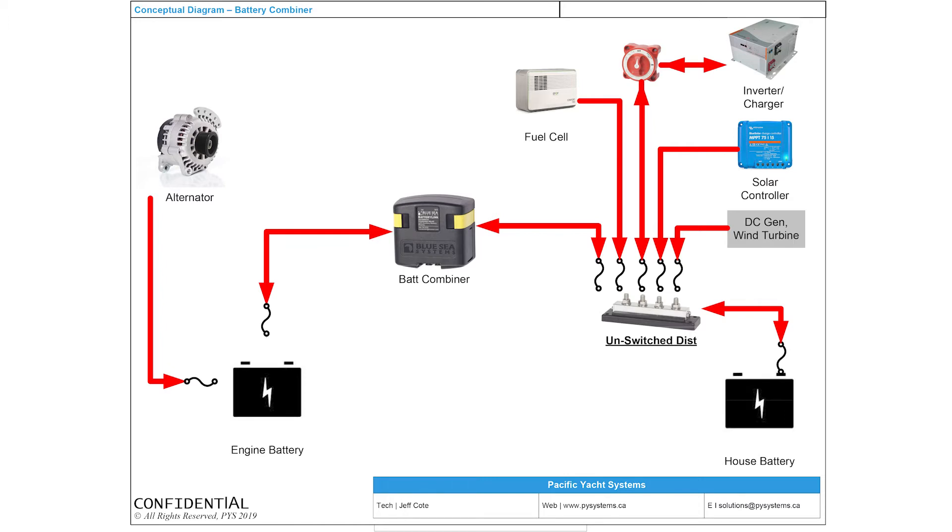Now, in an ideal world, a battery combiner and a battery charger might be doing similar things, so you might wonder if you even need both. If your battery charging is working, you might not need a battery combiner — but there's really no easy way to disable it. There's no negative implication either: your battery charger outputs charging voltage to each battery, and the battery combiner shares battery voltage. Conceptually they overlap, but there's really no negative consequence to running both simultaneously.